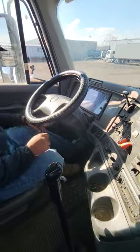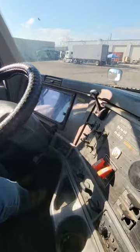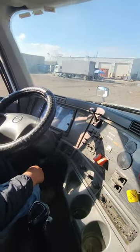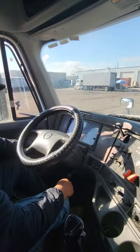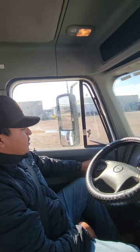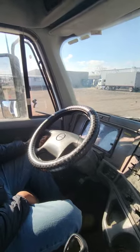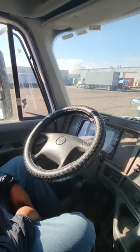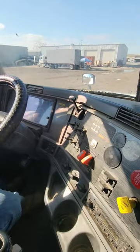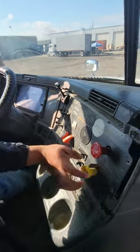Now I'm going to my electrical components. I'm going to turn my switch on. This tractor is equipped with ABS — I know this because my ABS light turned on and off. Now I'm moving to my lights. I have my daytimes, my low beams, and my fog lights. They're not cracked, bent, or broken. They're properly mounted and secure. My windows roll up and down. They're not cracked, bent, or broken. They're properly mounted and secure. I have my left turn signal and my right turn signal. They're not cracked, bent, or broken. They're properly mounted and secure.